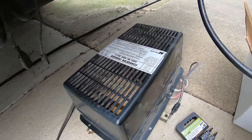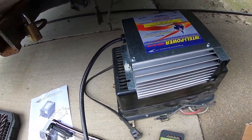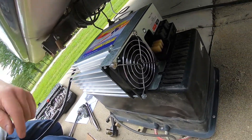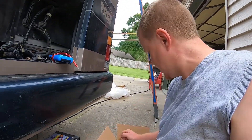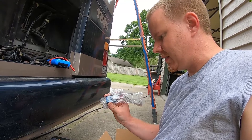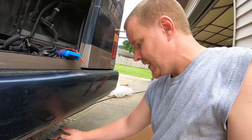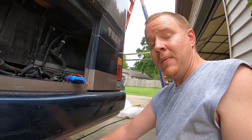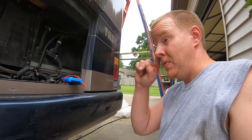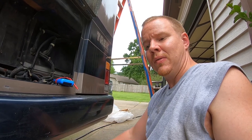So that was a 50 amp unit, and here's our new Progressive Dynamics 60 amp unit. This has got fan cooling, is set up for multiple battery taps, and it also came with a remote monitor to check its charging status all the time. It's going to be a lot lighter and a lot easier to work with. This has got a smart charger built in, so it will not overcharge your batteries, but it will maintain them constantly. You can leave this plugged in a lot longer — it's just going to float charge them. It won't overcharge your batteries.